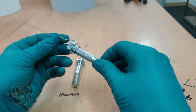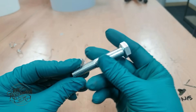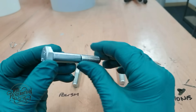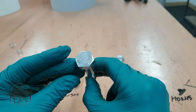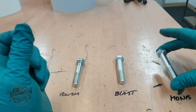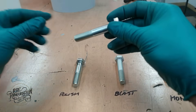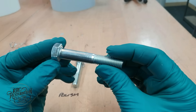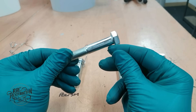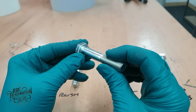Behind that we have the vapor honed bolt. It's a lot more shiny but you can still see traces of the honing on the surface. I don't really recommend this surface finish — it's okay but it's not the best. Third we have the wire brushed finish which is more than acceptable. It looks pretty much identical to the zinc plating I took off, so if I can replicate the manufacturer's zinc plating then I'm quite happy.